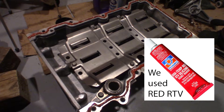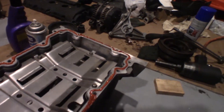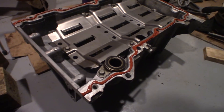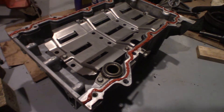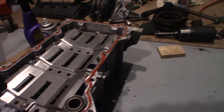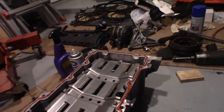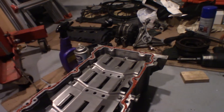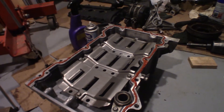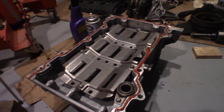The oil pan is all assembled and I put a bead — you want to do a bead of about a sixteenth to a quarter inch, all the way around, a continuous bead with no breaks. You can see how I went around the bolt holes on the inner side. I'm going to let it just set up a little bit, just let it flash over, and then we're going to go ahead and put it in place. It's going to be a little tricky, so we don't want to bump any of the gasket maker when we sit it in place. I want to lift it up, start a couple of screws — I don't want to push it up to the mating surface just yet — get the screws going around it, then push it up once we know it's all lined up, hand-tighten all of them down, and give it about an hour to set up before torquing.